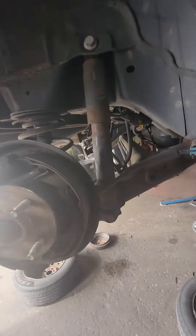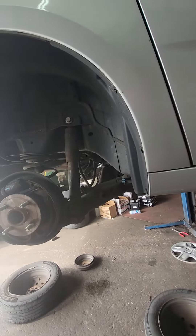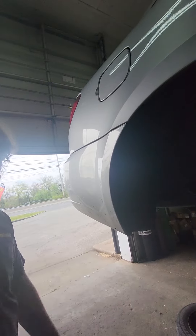This side is completely loose and rattling, but the suspension's hanging down on it, and he doesn't want us to do anything about it. These are at the end of a very useful life. So that's why that wheel locked up — the spring broke and rotated around. Interesting. Thanks for watching.